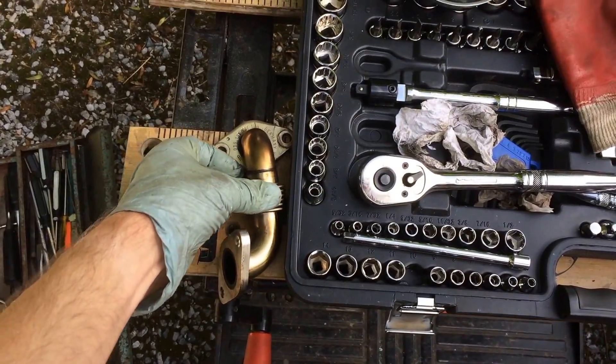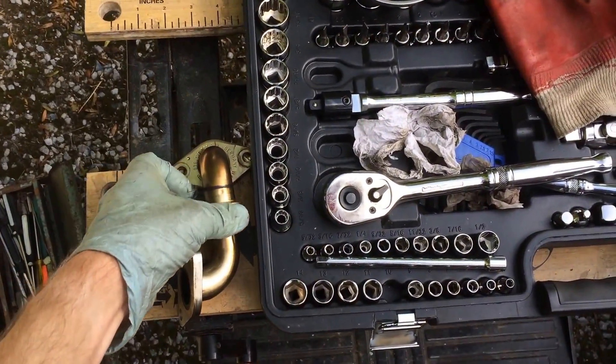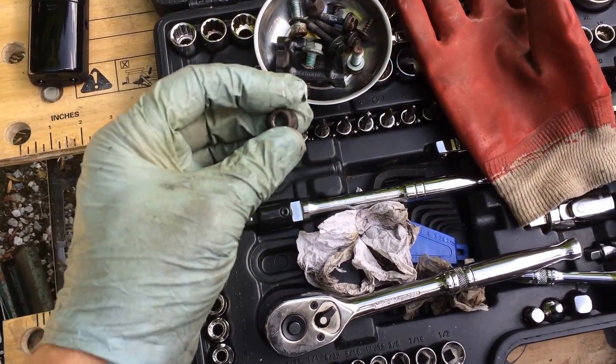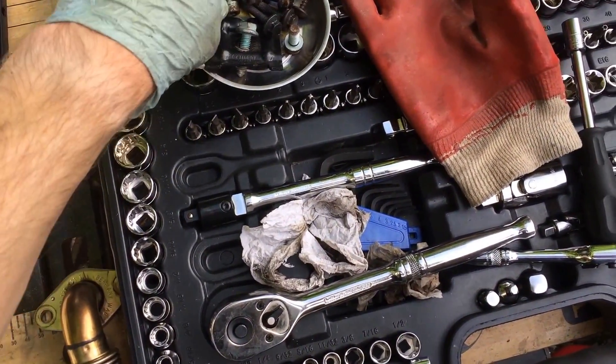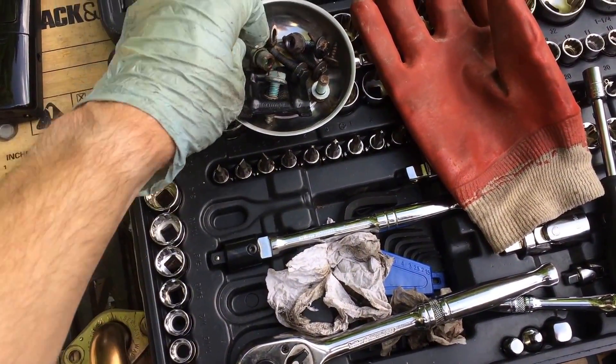So that's my approach. I'm going to take the EGR pipe off and get the Mr Muscle in. You can actually feel the actuator by putting your arm in there, and I'll try to free it up. I've now removed the EGR pipe — it's this piece here. It's held in place with two 13mm lock nuts on the manifold and two M6 Allen headed bolts on the EGR valve.